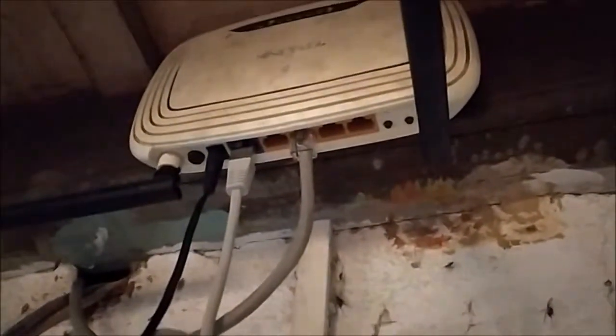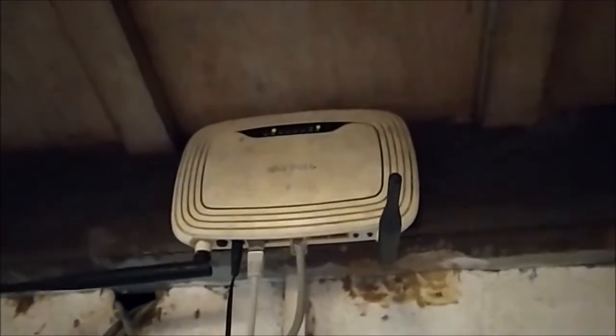The LAN cable comes to the POE splitter — power comes at one end and the LAN cable goes to the router. I already had an old TP-Link router, so instead of connecting directly to a laptop, I connected to the TP-Link router so that my smart TV, smartphones, and all family members can connect their devices to the internet. Any Wi-Fi router will work for this. I'm also running it on a UPS system so I can have internet 24 hours a day.